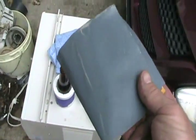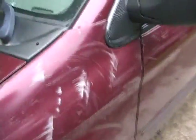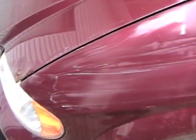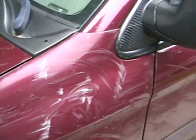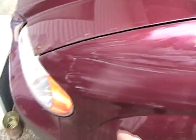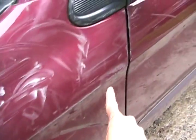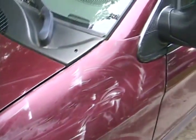After about five minutes of sanding and a bunch of dipping in to refresh the water on my paper, you can now see the sanded clear coat residue. When you're doing something like this, it'll slightly change the texture of shine — you'll have a different texture of shine on your body than everywhere else. I've chosen a panel to do, and a good panel is always one that you have a body line to work with.